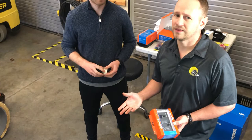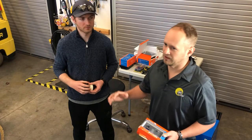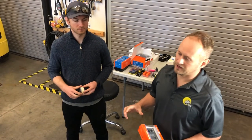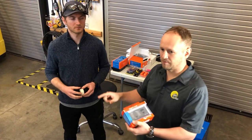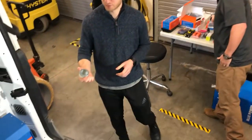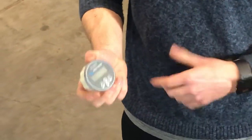With a power system this powerful, I don't want people to think they're running a power station — I want them to enjoy camping. It's just going to take care of itself and be there for you. So I try to keep the monitors and displays on the walls to a minimum. But if you really wanted something, we sell a Victron Color Control GX monitor that gives a full-color animated display of how all the systems in your rig are interacting — where all the power is flowing, the status of the batteries, how many charging watts you're getting from solar or shore power. This is the BMV 712 battery monitor, which also has Bluetooth so you can log in with your phone and see battery production instead of looking at the smaller screen.